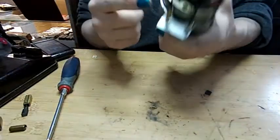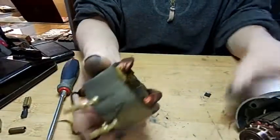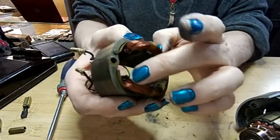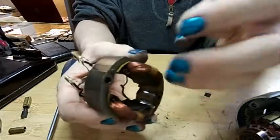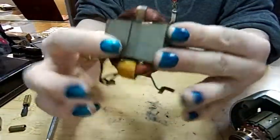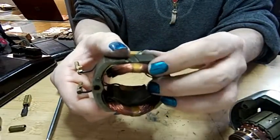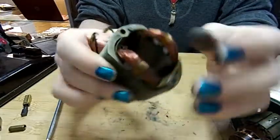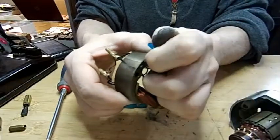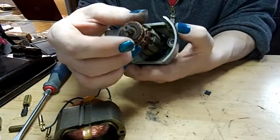I am going to take the outer windings out — they should just slide right off. You want to inspect them. See how these are kind of filthy, but mainly see how they've got a nice copper shine? If you tear this apart and they are all black and burnt looking like toast, then unfortunately you've got a motor you probably can't save. This is critical — this reddish, shiny-ish look is the insulation they paint on these. If these motors run hot, that melts, they make solid contact, and the motor is shot. You want to look at these windings as well.